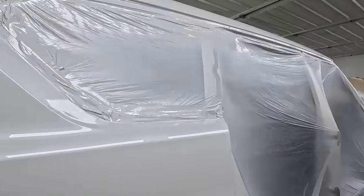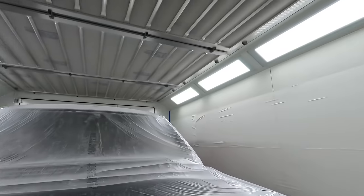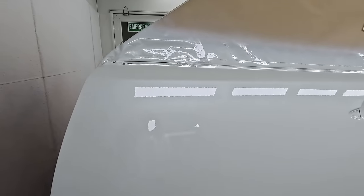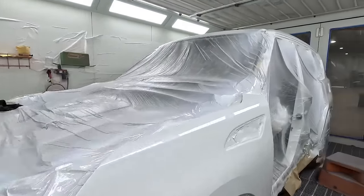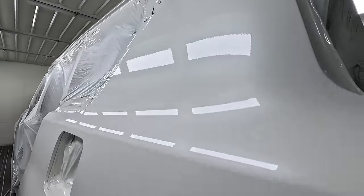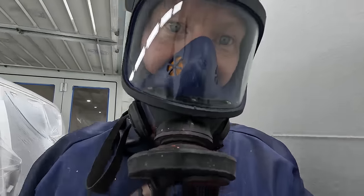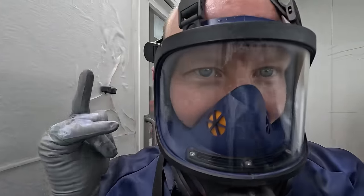That's a nice tight finish — it will pull back a little bit, I know that, I've been doing this long enough. I did actually bake it for 20 minutes before I cleared it just to have the die back settle a little bit, and the 30% reducer does help too. It's looking nice and straight — we didn't seem to miss any dents or anything. Actually, I did see one up here on the pillar, we may have to get that PDR'd. Next step I will bake it — even if it's the last job of the day I still like to bake it, even if it's just 20 minutes. Anyway guys, see you in the next one — get out there and paint some!